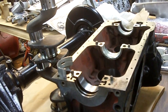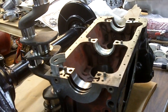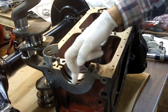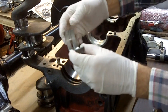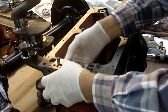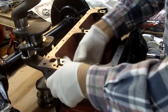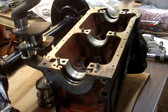We'll go through this process pretty quickly. Notice that we are doing it without the rear crankshaft seal — we don't want the seal in there because it can produce drag. First thing we're going to do is make sure we put our main bearing shell in correctly, the one that's got a hole in it for the oil passage, for the oiling hole in the crank. We've already got oil on there, but if needed we can just take a little squirt of oil and put it on there.